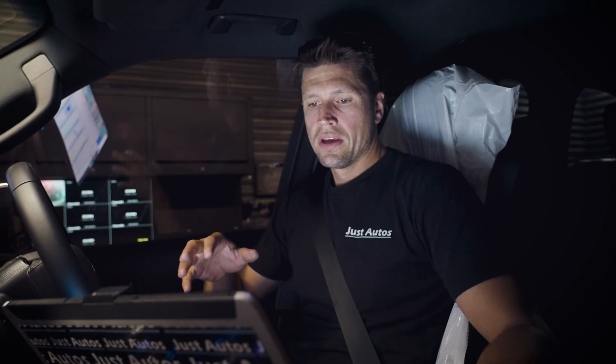I'm going to run through exactly how the car is in stock form and show you the temperatures of where everything's sitting. The great thing about the 300 series is that because they're a water-air intercooler, I can log things like engine coolant temp, coolant temp of the actual intercooler system, and intake air temperature before and after the cooler. With this information it definitely helps us collect a lot of data and understand what's going on.